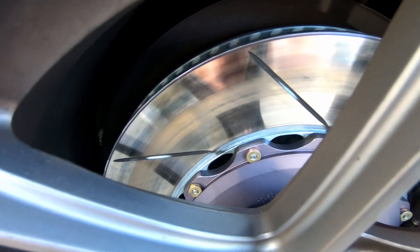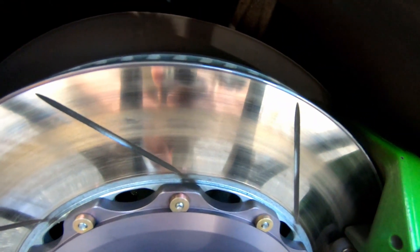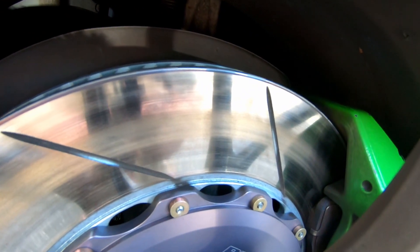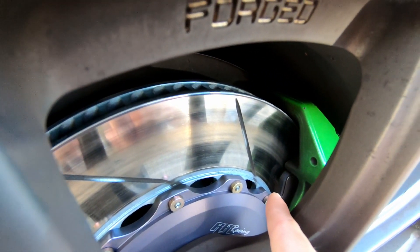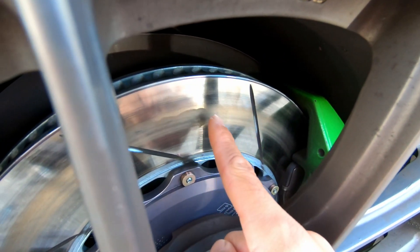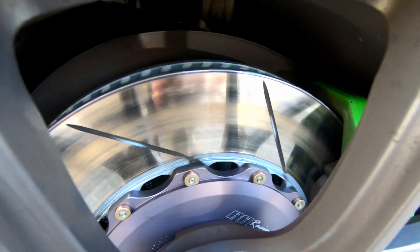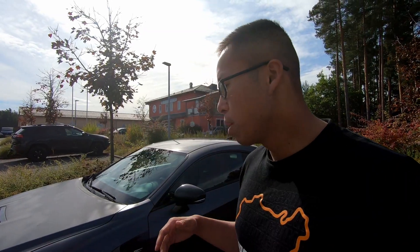What you can also see is that in this area, you can see a little bluish tint, and that is what they describe when they talk about having a bluish tint film. That is from the brake pad material going onto the brake rotor itself, and then being heated so much that it gets infused into the brake rotor. Essentially, bedding in brakes means you're going to break in the new brakes.